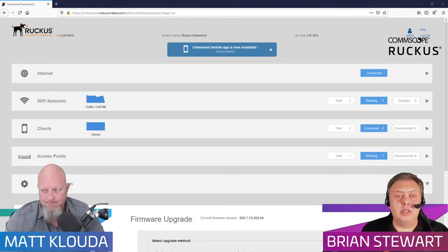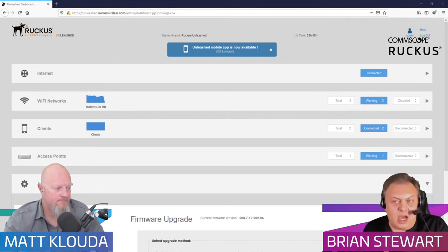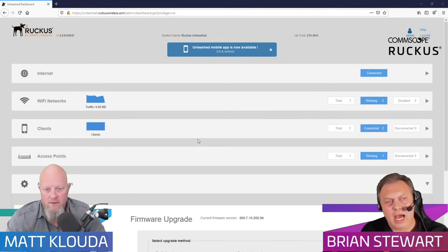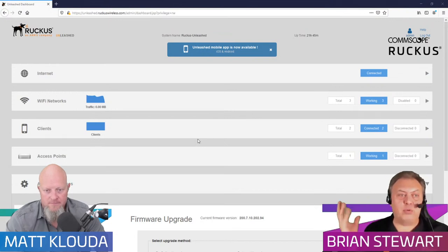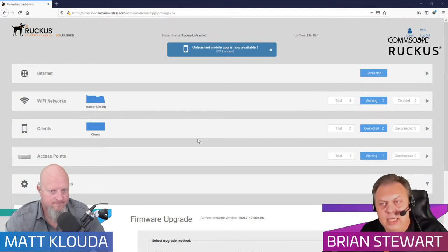And another one, make sure you're not on a VPN as well. This gets in depth, but if you are on a VPN that's not what's called a split tunnel VPN, then everything you're doing goes directly through that VPN and doesn't actually talk to your own home network. So that would keep you from getting to it. So check for that as well. Things like parental control apps may push everything through a VPN on the back end to track the children's behavior. There are a lot of other things that will automatically run a VPN, both for mobile devices as well as for Windows. So definitely check that as well.